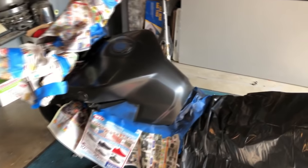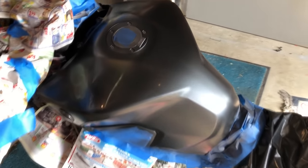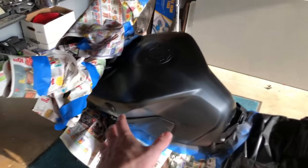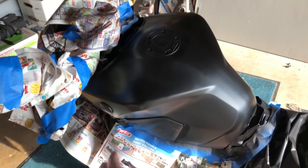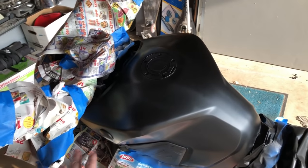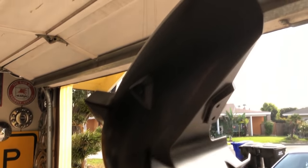I'm putting a 15-minute timer between coats - any longer than that is unnecessary. I'm not doing super heavy coats. I am a plasti dip guru - the king ricer when it comes to plasti dip because I know how to do it correctly. It's only been five minutes and I'm already getting kind of excited - that's kind of how I want it to look, just a nice sleek shine. A couple coats later and I'm getting a little nervous now. This is the biggest piece I've ever dipped before, and as expected I'm getting some streaks. To fix that I'm going to spray it on a bit thicker for the next two coats. The other smaller pieces look fine - they're a lot harder to mess up.